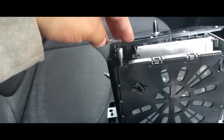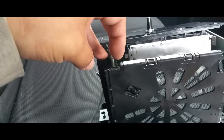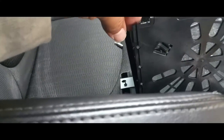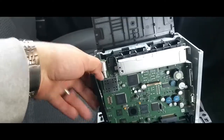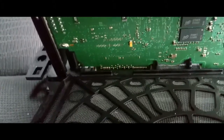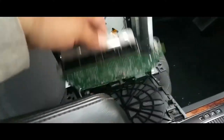After you do that, take all the screws off, pop this open a little bit, take all the screws off, pop these to the side so you can access this, and then try to pop these open. It's going to take a little bit of process but you'll get it out. Once you have that, this flaps open just like so and you're able to access the chip. This chip is seated on these two tabs just like so, and it has a ribbon cord that plugs in there. You need to open up both radios and swap out these chips.